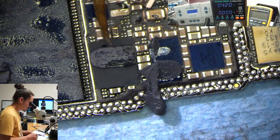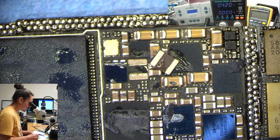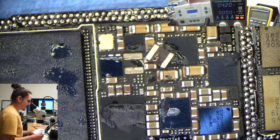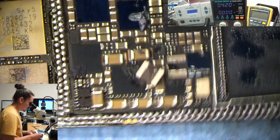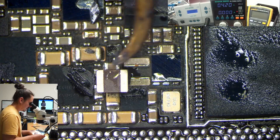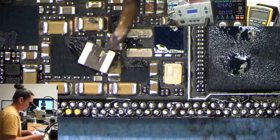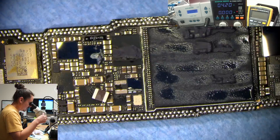The boost coil fell off. Yeah, so this is a common problem on the 12 Pro — that's why I knew to check here. I just need to get a new one of these on here and this will turn on again and I'll be able to pull data. So this is good, this is quite an easy one — I'm glad to see this.